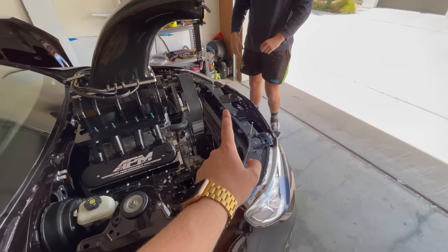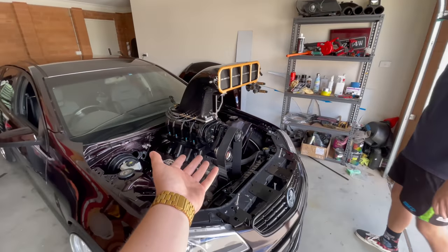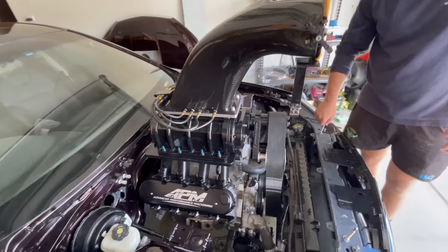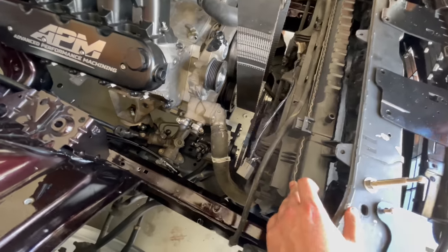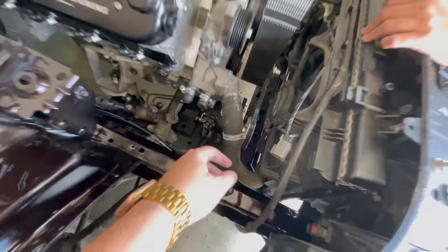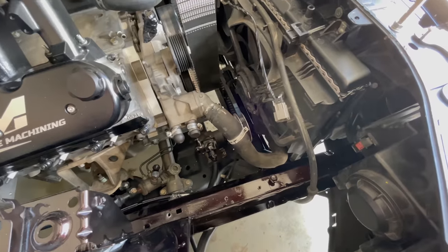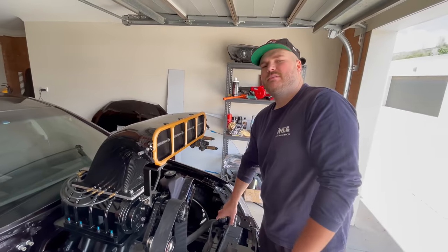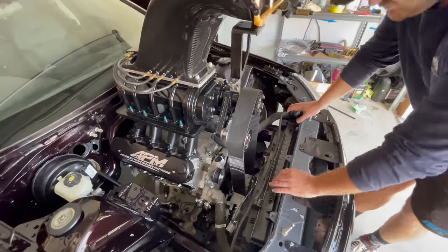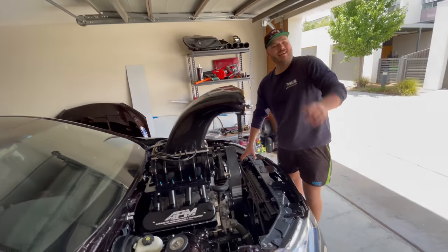Apparently they put in heaps of R&D for the VE/VF radiators and they're actually really quite good. One of the amazing properties of running methanol is the cooling — it's going to run so cold that we can get away with just running the OEM radiator. The only thing we have to watch out for is the hoses getting sucked flat. We might upgrade to hoses with spring wire through the middle to keep them open, but we'll get there. We don't know if it'll actually suck flat, but we're ready to find out.